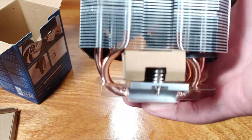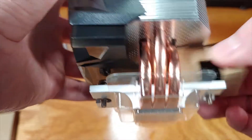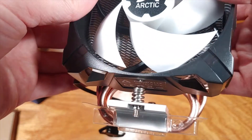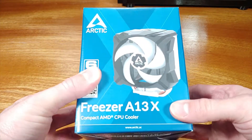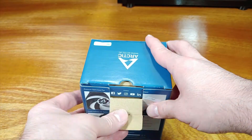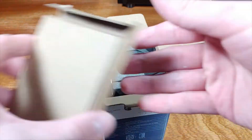The Freezer 13X cooler is a single tower cooler with three direct touch heat pipes. These heat pipes run through the base of the cold plate or the heatsink to increase contact. Arctic has offset the heat pipes as they go through the cooling fins for increased performance. Despite the low MSRP, this cooler does come with a 4-pin PWM fan, which is nice to see. The included cooling fan is a 100mm fan, called the PFAN. Despite not being a 120mm fan, it did prove to be adequate during testing. This fan is able to spin all the way down to 300 RPM for virtually silent operation, or all the way up to 1300 RPM for maximum performance at roughly 24 dBA.